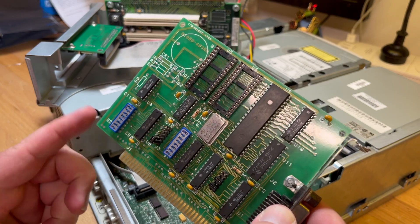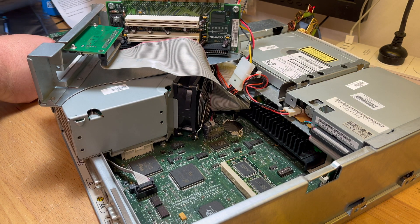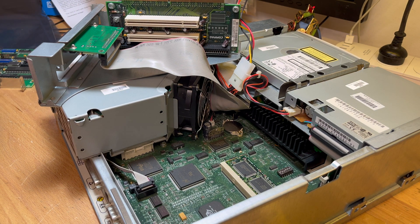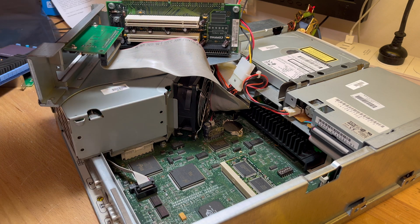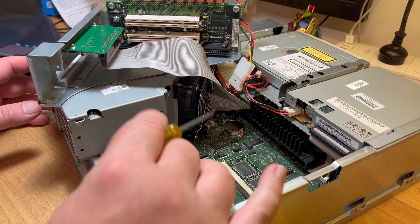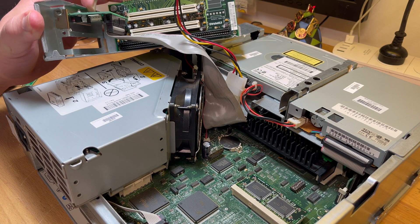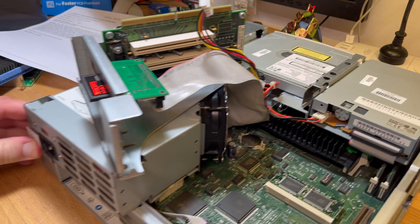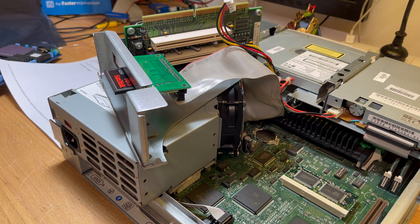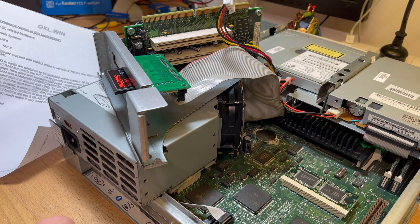It's definitely 16-bit - I've got a few of these from 1986. There's a battery in here - I wonder if it's dead by now since it hasn't been running for a while. It looks like a CR2430. I'll make a note of that and get a new one. Let me get this card installed and download the software, and find a keyboard and mouse.